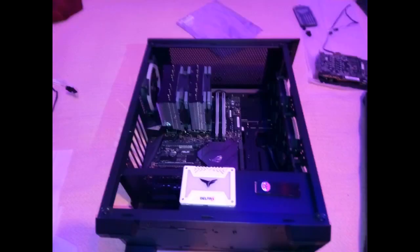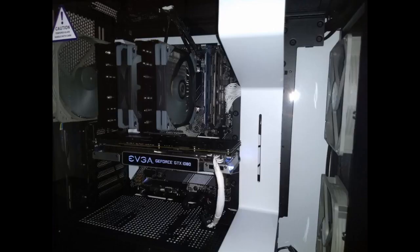Great cooler. From my testing appears on par with Noctua NH-U14S or NH-D15S. It is also about as easy to install. The mounting system is good and it comes with a nice screwdriver that is useful for other things. Does not interfere with RAM slots at all. I think Scythe will be my go-to CPU cooler from now on for performance and value. Knocks everything else out of the park.